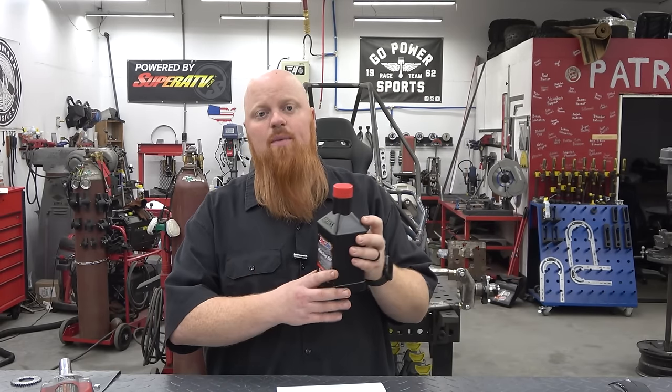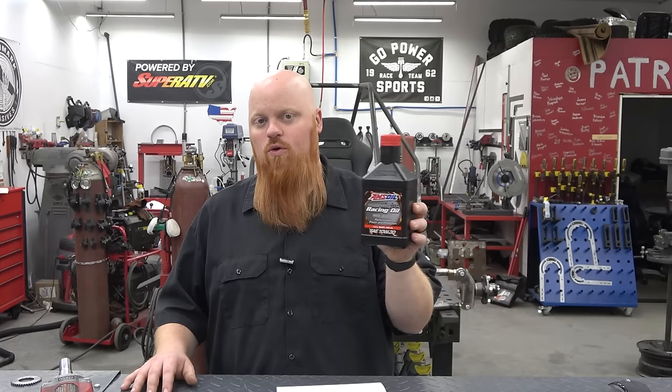A while back we did test to see if there is a difference in horsepower between the break-in oil and the Dominator racing oil. Actually we gained half a horsepower when I tested it off camera, but I was like, okay, this could have been just a temperature change or something. But we gained almost half a horsepower by doing it in this video. So you can successfully say you can get almost half a horsepower more by running Dominator racing oil over the break-in oil. So that's pretty impressive.